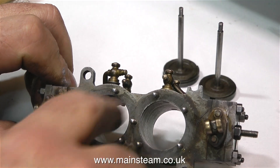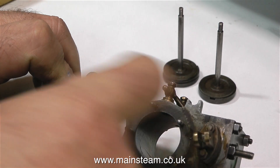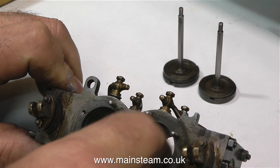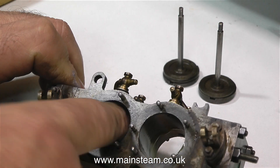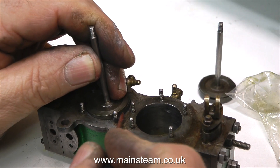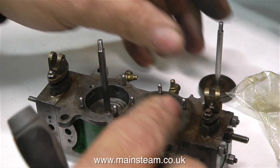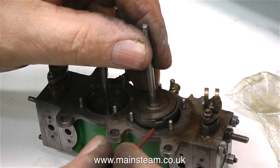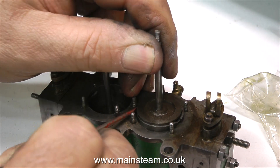With the one-inch adjustable reamer firmly in the lathe chuck, I rotated the chuck towards me and rotated the cylinder block away from me, and after about an hour eventually both cylinders were the same size. I couldn't video it — it was too difficult to get the camera in and I really had to concentrate on what I was doing, because it would have been very easy to make a mess of this.